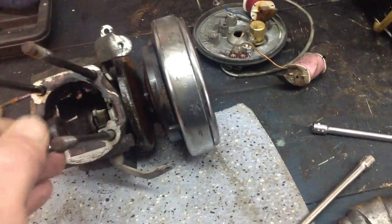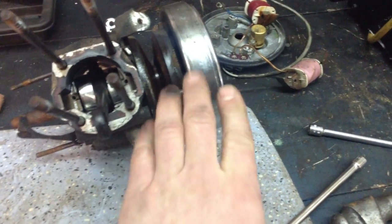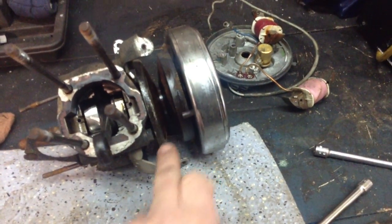I've been through the variators - these are how these shift. This one's frozen. I was hoping it would have had a four-ball. With a four-ball you can take two balls out and it makes a higher revving engine.